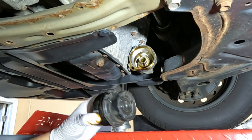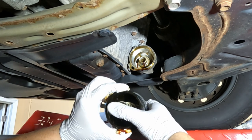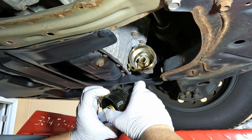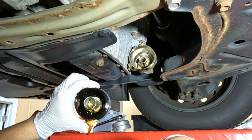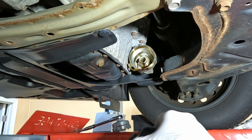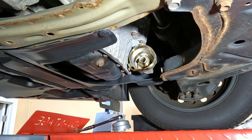Here's the cap. Obviously dirty on the outside, clean on the inside. I also like to push the spring on this to make sure it moves nicely, because this acts as a bypass — since this is the actual cartridge, with spin-on style filters it's built into the filter, but these are not. You can see in there it's absolutely beautiful, nice and clean, good spring retention. Everything looks good. I'm just going to let this thing sit for a few minutes to let everything drain out, then I'll get started on the sump itself.